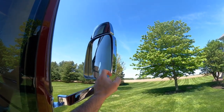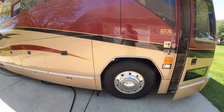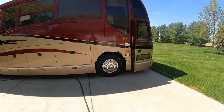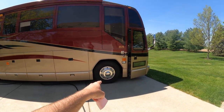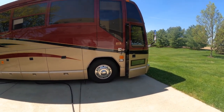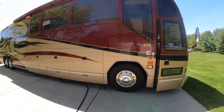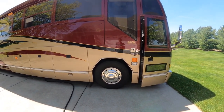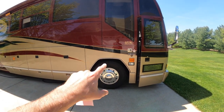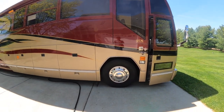When I'm going down the road it does one of these deals and it's hard to see. The other issue is the front airbags — when I put it in storage, one had dropped, so I was afraid it was the airbag itself. I bought two new airbags and have them sitting in the garage, but it holds air, so I think it's probably a valve somewhere. I'm going to go through the accessory air system and see if I can find that.